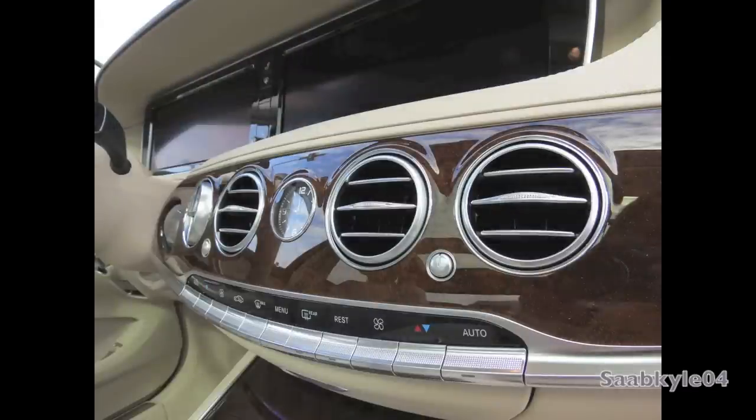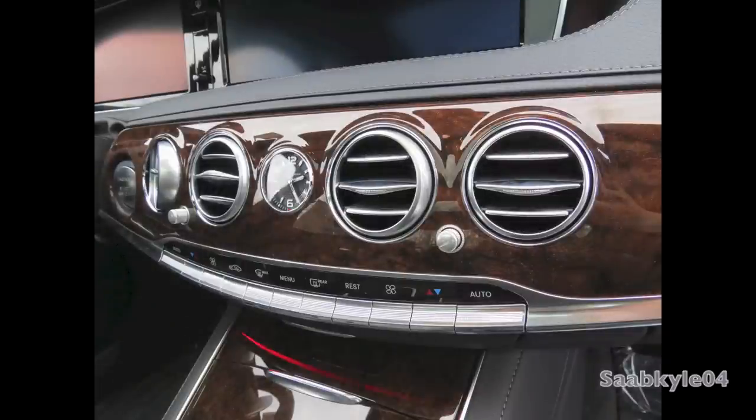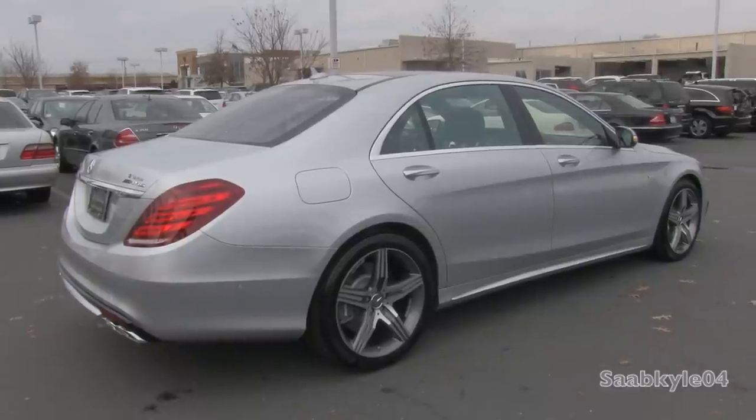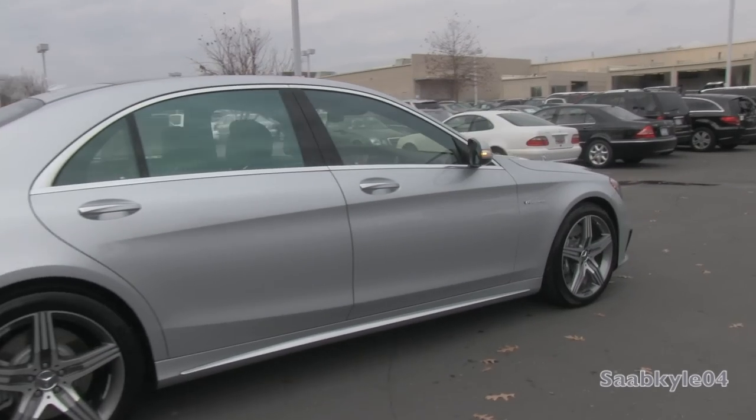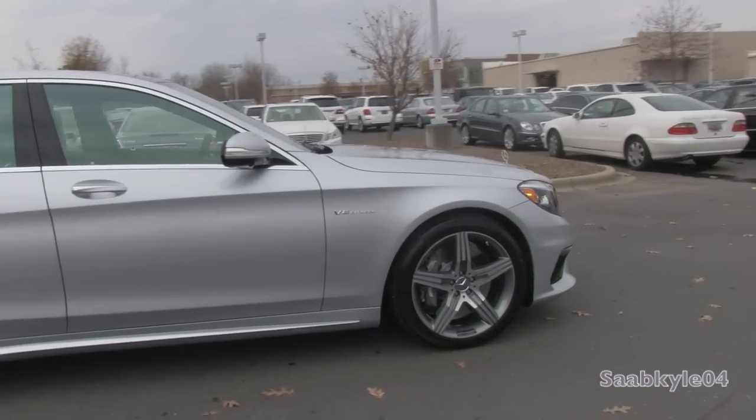Distronic Plus, the vehicle's adaptive cruise system, provides the necessary data for the pre-collision system by monitoring traffic patterns and lane changes. It also has the ability to apply about 40% of brake pressure to assist in stopping if the driver doesn't react quick enough, and can bring the car to a complete stop from speeds up to 125 miles an hour.